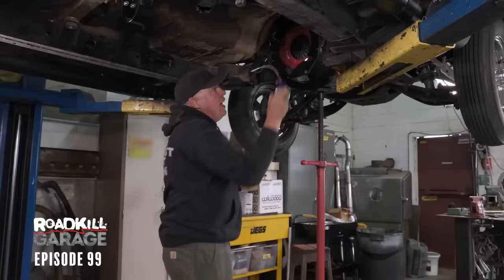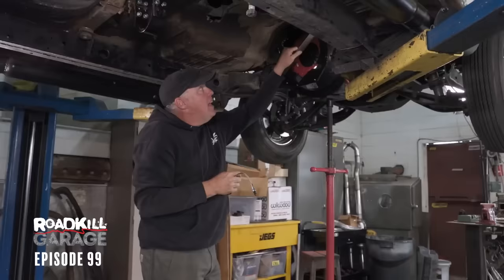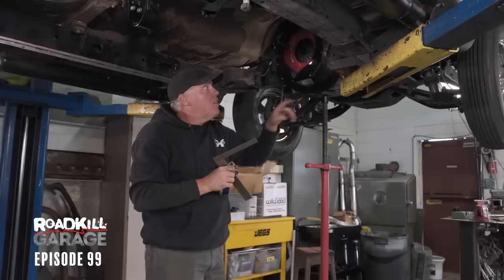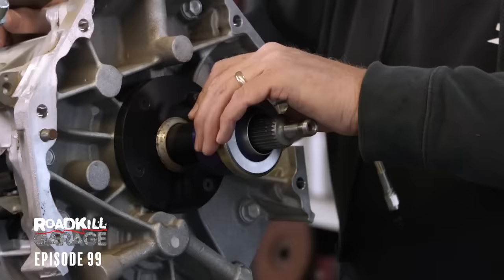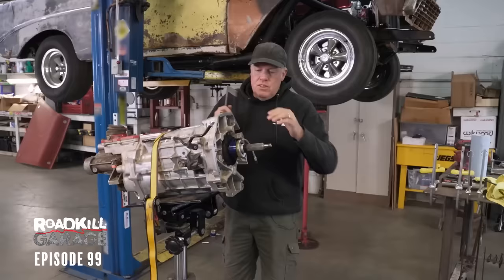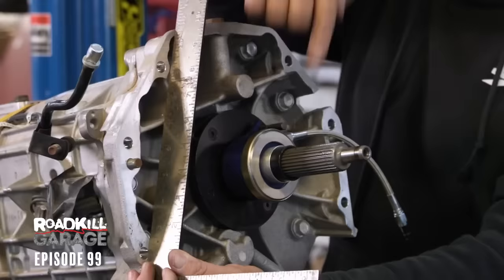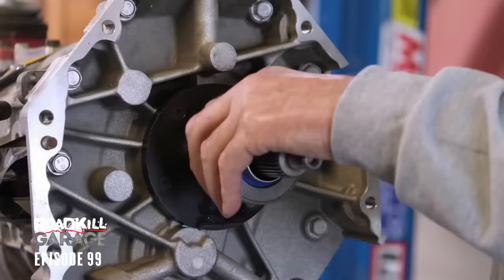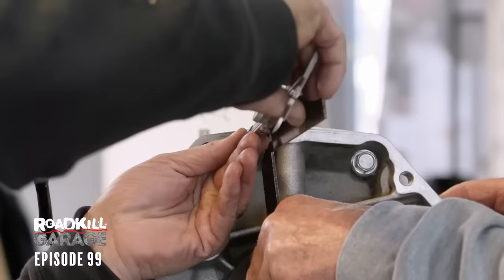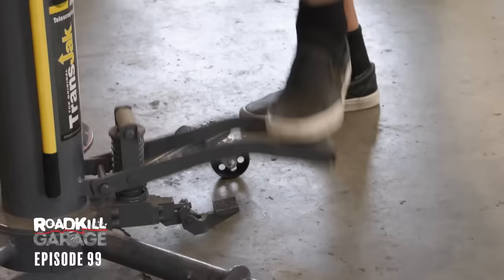The way we're going to measure that is I'm going to put a straight edge across and use a dial caliper — the stick end of it — to measure from the fingers to this face. Remember the transmission bolts to this face, so we put the throwout bearing over the bearing retainer on the transmission and measure from surface to surface. Then I subtract that measurement to tell me the distance from here to that clutch finger. To adjust it, I have little spacers that go right behind it. We've got it set up with shims now so the clearance is 155 thousandths — they recommend 150 — so we think we're good and ready to throw it back together.